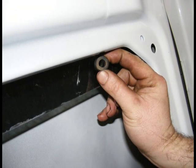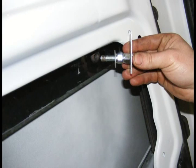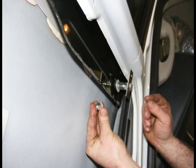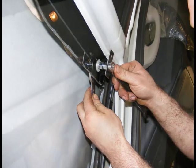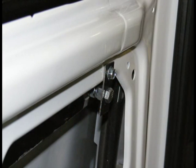Window modification. Install the front window supplied round rubber grommet in the forward window hole. Install the supplied window bracket assembly through the grommet and glass with washer and nylock nut and tighten. Caution: avoid over-tightening. Make sure the window is in the utmost position and use supplied self-tapping screws to secure the bracket in place.